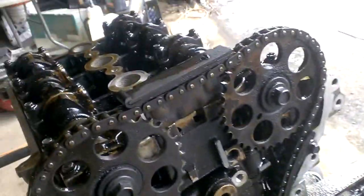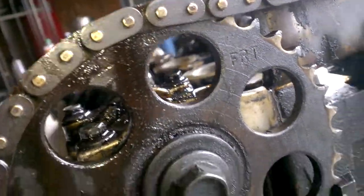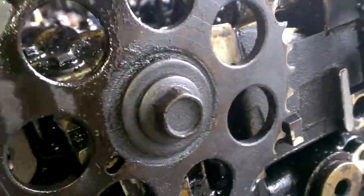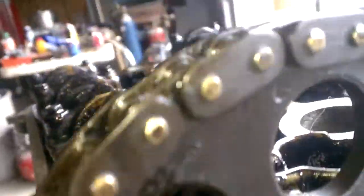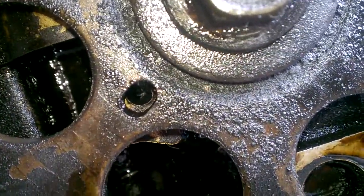The timing system is actually pretty complex. Now with Saturn, it kind of made it easy — it's going to vary on different engines. But what you're going to be looking for: you've got that little divot there on the exhaust, and then you have the alignment pins. You'll notice there's a hole in the cylinder head behind these.